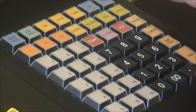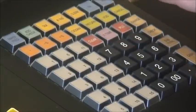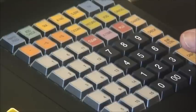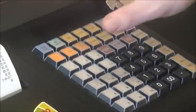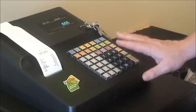The first button we're going to explain is the clear button. This button will stop any nasty beeping you may receive by pressing the wrong button inadvertently when learning your cash register. For example, if we don't enter any sale and try to finalise on the check button, you'll notice E1 on the display, which means a sequence error and a nasty beeping noise. Clear will always remove a beep.